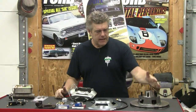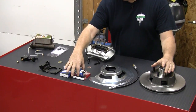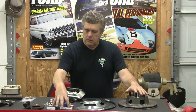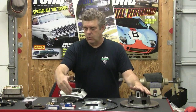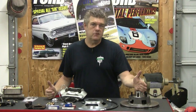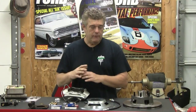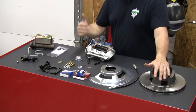I'm going to talk about the rotors for just a second. The rotors come with the races already installed and ready to go. It also comes with another set of bearings and races. Now, the races that are in here are Timken races — looks like a really good system. But they're including these, and these are both by PTC. I don't know if you want to take the races out of here to put these with them so that you have a match set of races and bearings.